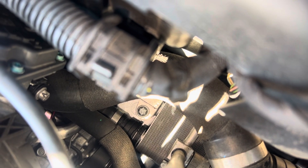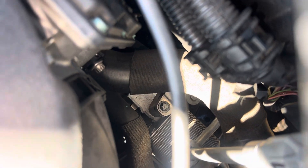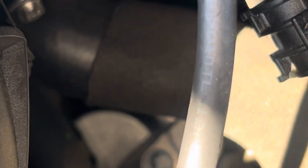Let me zoom in and get it steady for you. Do you see those little flat lines? That is a plate heat exchanger. This is the high-side connector right off of it. Do you see that hex nut down there? That star right below and behind it is a receiver dryer. You can see the rounded part — right there — that is the receiver dryer.